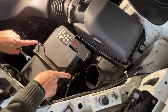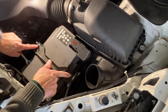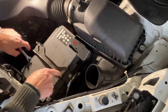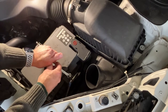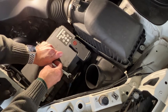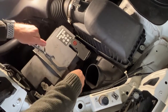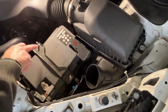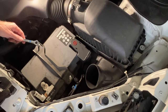We need to remove this bolt, and there's another bolt underneath this wire loom connector. We need to get that off of this threaded rod — these things are hard to get off. Putting a wrench down here and pushing upward really helps. Now we just need to remove these two 10-millimeter bolts. If you have a really long deep-well socket you may be able to do it that way, but a wrench works just fine.